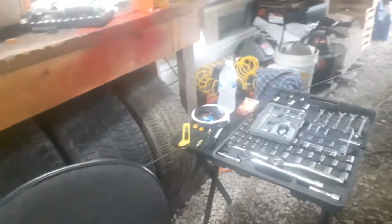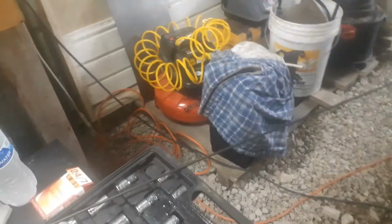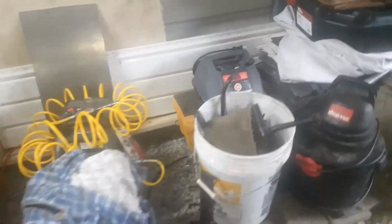I've got a pipe cutter in here somewhere. Wow! Spiders everywhere. Spiders are invading the garage. There it is. Alright. And probably need this, the drill bits I use after I cut it. It kind of boogers up the threads, or not the threads, but the hole. So I use the drill bit to go in the hole to make sure the hole's nice and straight. I got a file around here somewhere. I thought it was in that bucket, but I think I put that in here too. There it is. A lot of spider webs.